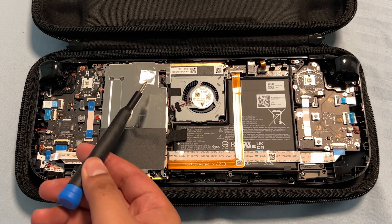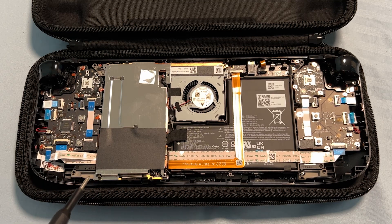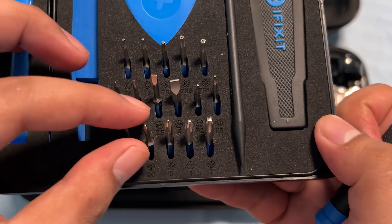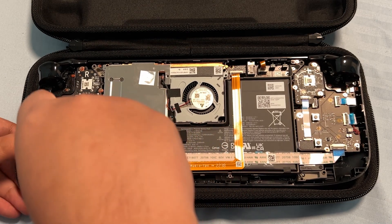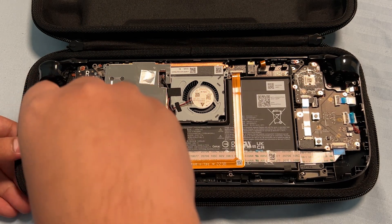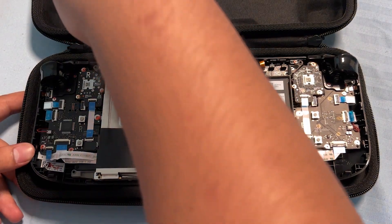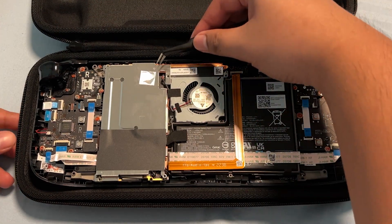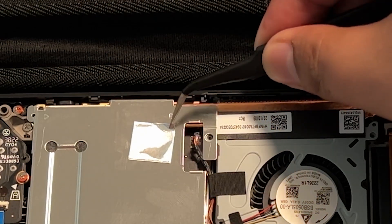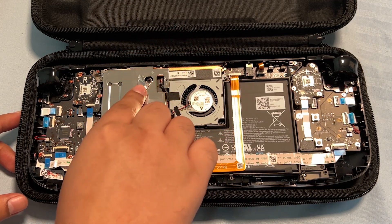On this part, we're going to remove three screws — one here, one here, and another here. You can use the same screwdriver tip, but I like using a double zero for the screws on the inside. For the adhesive foil, I'm going to use tweezers to peel it up a bit, but you could also use your fingernails for this. And there's the third screw.